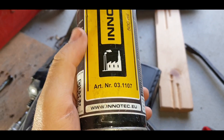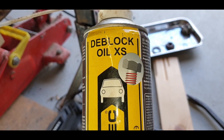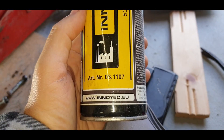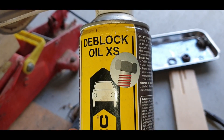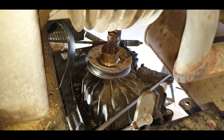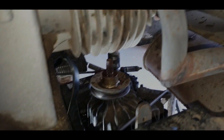I'm going to give it a shot of this stuff - I've used it for years, forget WD-40, this is what you need. Just give it a little squirt and sit back and let it do its thing. This has got me out of all sorts of pickles - manifold nuts particularly, we all know what exhaust manifold nuts are like, but this stuff sorts them right out. I don't want to give too much because you don't need an awful lot, but also we're hunting an oil leak so I don't want to smother it and then not know for definite that the seal was the problem.